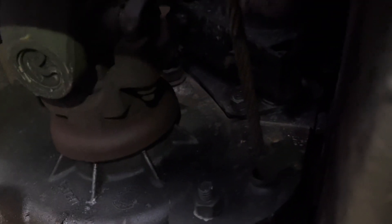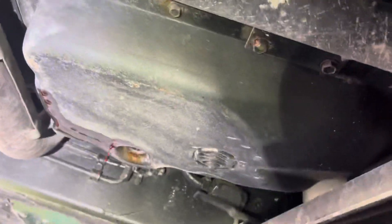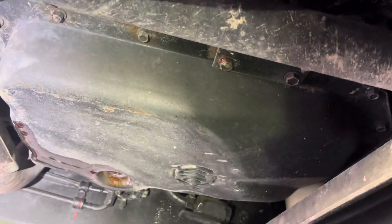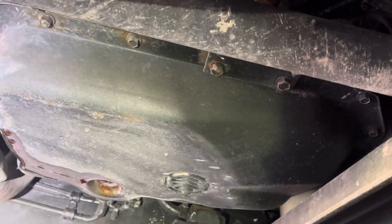The plan is I'm going to basically loop those hoses back on itself with some 3/8 transmission line. As a result it'll basically be no longer passively cooled, but as long as you're not doing over 55 all the time, doing some crazy stuff in the desert and the heat, and you're actually paying attention to your rig, you shouldn't actually encounter any issues.